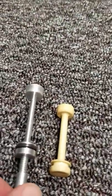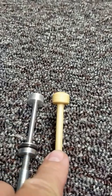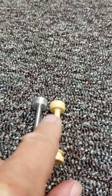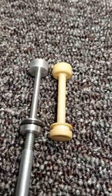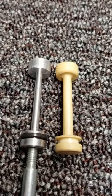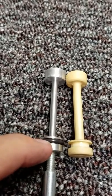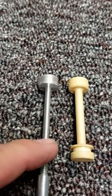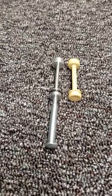So this is our high performance barbell that you can find at Sac City Corvette dot com. They do make a difference — people tend to overlook these little barbells, but as I showed you, unfiltered oil can go right past them up to your bearings, at around 500 microns, which is pretty significant considering your oil filter does around 20 to 25 microns depending on the filter type. This is probably a worthwhile investment. The only thing you'd ever have to replace when you rebuild is the Viton ring, which you can also get at Sac City Corvette dot com. I hope you enjoyed the video — go pick one of these up. Thank you, I'll see you next time.